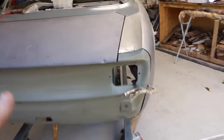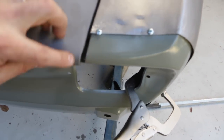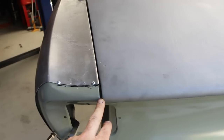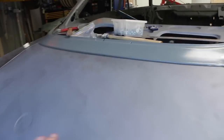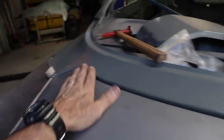We're just loosely screwed together now — it's not actually lining up yet. I've still got to do some more adjustment: I need to bring this panel back this way a little bit further to make it line up there. Panel gaps are not too bad at this stage — it's a little bit broad at the top coming down to a little bit narrow at the bottom, but it's not too bad. This tail section is going to come back a little bit, but it's really coming together. It's actually looking like a car again. Panel gaps on this side are all really nice and the back end is all coming together. There's a little bit of movement needed on the boot lip — it's a little bit high here, but it's nice and even on each corner.